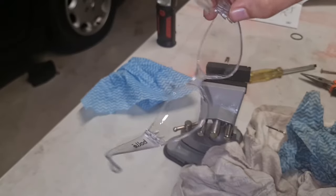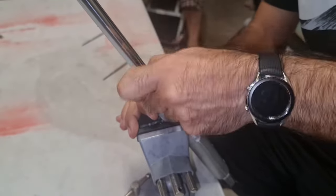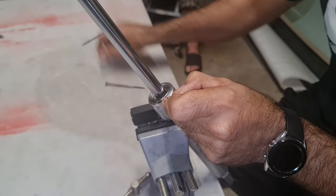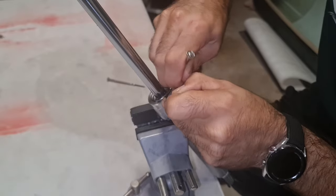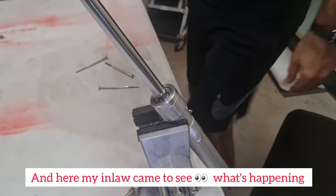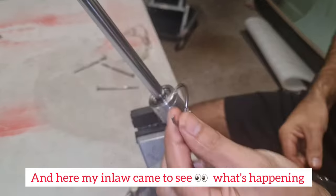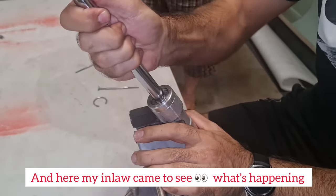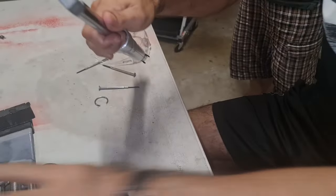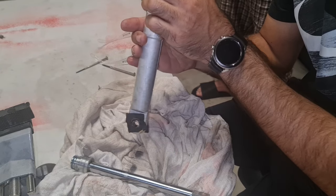Please make sure you wear eye protection as well as hand protection and gloves, because this is going to be dangerous. Removing the C-clip is very easy — you only need a small flat-head screwdriver. You might need two screwdrivers at the same time and a vise is very helpful. The C-clip is now removed. You just need to pull the shaft — actually called a piston and rod — out a few times and it comes off. Inspect inside the cylinder — there is an O-ring.